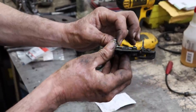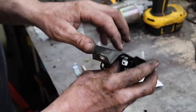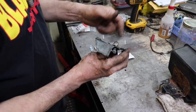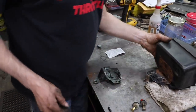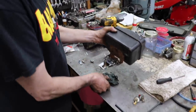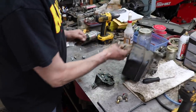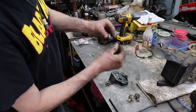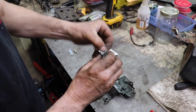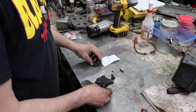When I took my plate off, the instructions say to slide this thing through and secure it with one of the screws, but the only problem is this plate is blocked off — it doesn't go all the way through. It probably came out after '80 or '85. So I went upstairs in my junk room and got a five-horse Briggs gas tank which has the same part on it, and this one goes all the way through. So now I can put this thing in there like this, because this is how it goes.